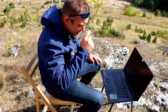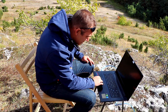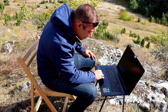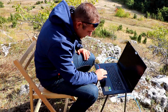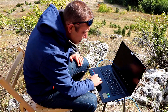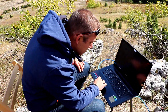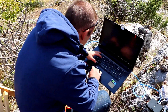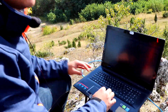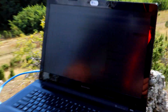OK, listen. Now, let's start with the built-in Ubiquiti tool. At this moment, at a channel width of 40 MHz, the capacity is 297 Mbits. That should be reasonable. Let's see if we can achieve that. First will be the local speedtest. We'll first see how it performs in duplex. It might not be clearly visible here, but you'll definitely have detailed screenshots from the conducted tests.